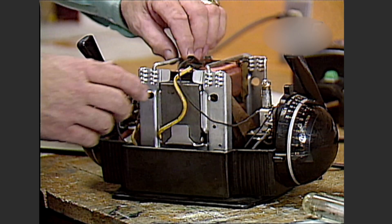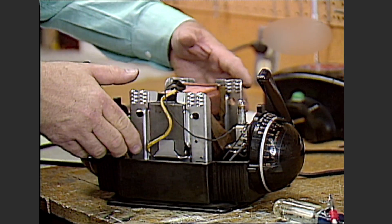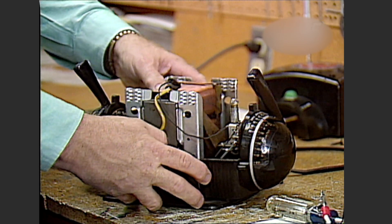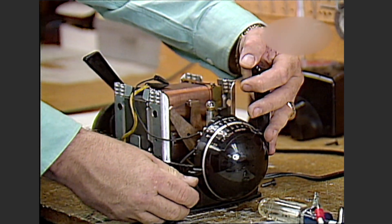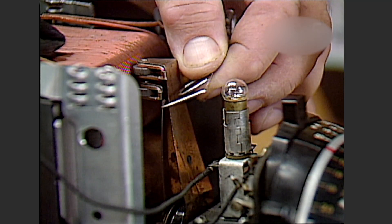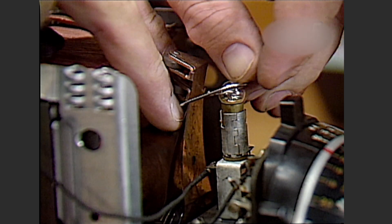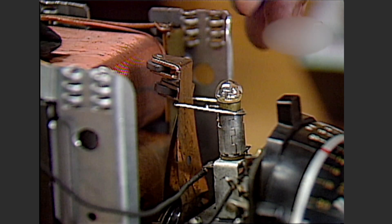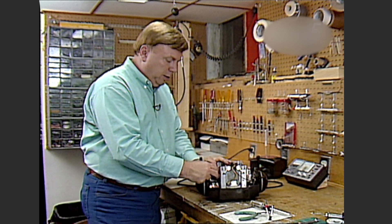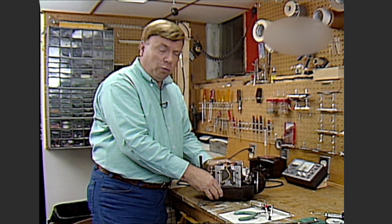In order to replace the line cord, we have to remove the two brackets and pull the holders back so we can lift the coil out. But first we need to secure the rollers so that raising the coil doesn't damage them. We'll wrap the homemade clip around both arms, turn it, and pull them back, securing those arms against the light post so they aren't touching the coil. Do this to both sides. Take the second clip, hook it around the rollers, hook it over the light post, and that pulls all four rollers away from the coil.